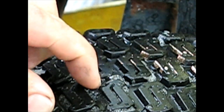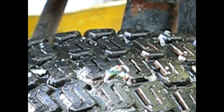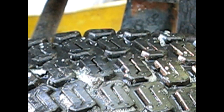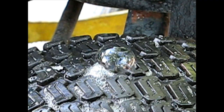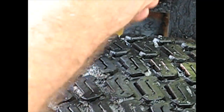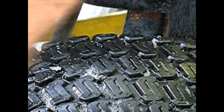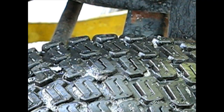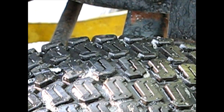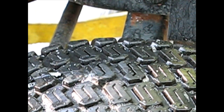Okay, so easy find. Somebody's got a tire plug in there already that is not holding. So, brand new tire? Not quite brand new. We'll fix that. Let me try to get that old plug to just come out. My guess is it's not much holding it in, being that it's leaking everywhere. Yeah, maybe I'm wrong. There you go. I just pushed it in. Won't hurt anything in there.